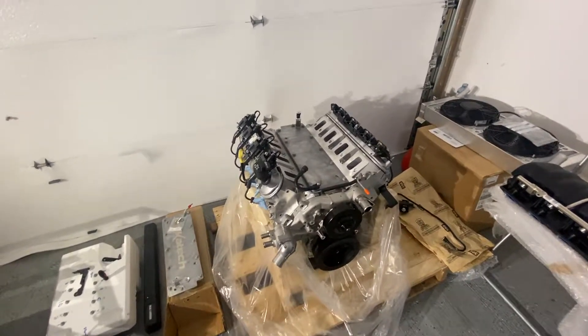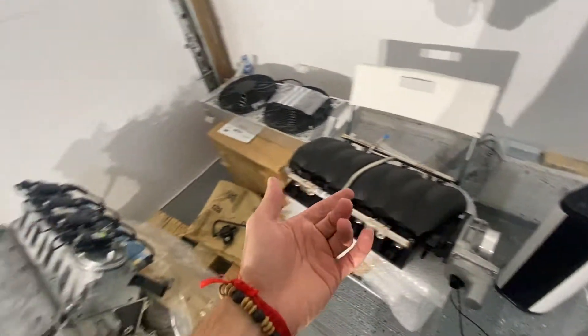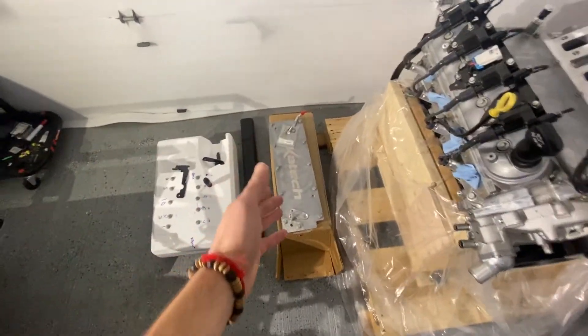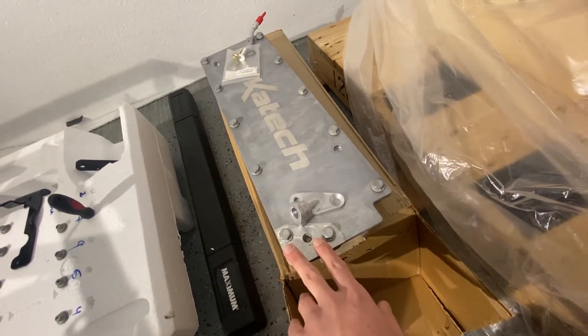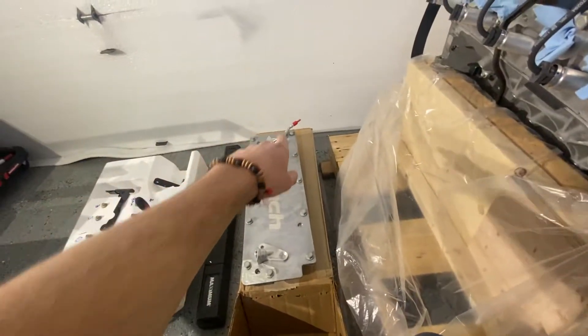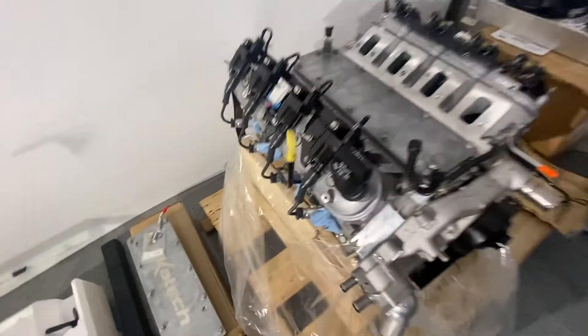So the way you go about this is that this sensor, as you can see, will eventually get in the way of this part when you flip it around. So what you could do is you could either cut that and adjust it — if you have more experience, that is no problem at all. But for us, what we did is we bought it ready from K-Tech. All you need to do is just put this adapter right on here when you remove that, and that's pretty much it. You just need an extension for this to fit right on there, but other than that, it's not a problem at all.